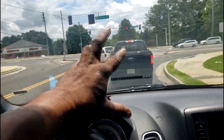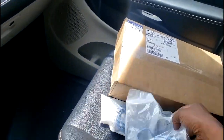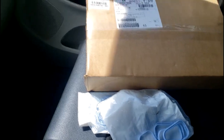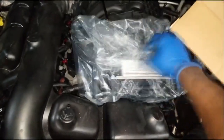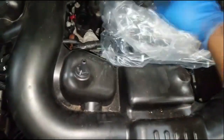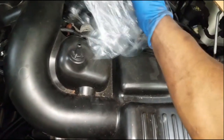Welcome back to the channel guys. I'm headed to one of my favorite spots, Brothers Motors. Look what I got — some parts! This is an oil filter adapter housing, brand new, the latest and greatest OEM. These are the upper and lower intake plenum seals. In order to replace these, the upper and lower plenum have to come off. I got the seals for both, and it's very important to use quality parts like this. This is OEM Mopar, and look at the revision — 'AF' — should be the latest and greatest, because I got this part from a dealership.